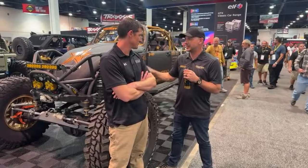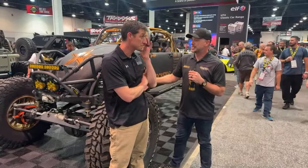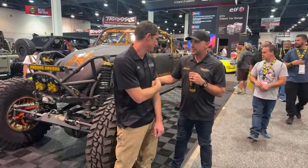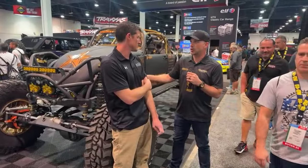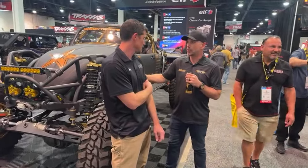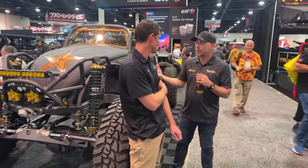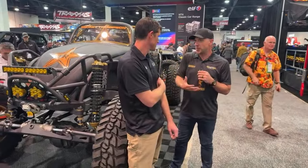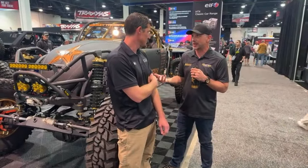Why I think this one is probably the most practical build for spools is because it's built in the styling of a moon buggy, right? But really explain to us why a spool is so much stronger than, let's say, a Grizzly or a Zip Locker or an ARB, things that people are more familiar with. Again, you can't run a spool in your everyday car. Yeah, it's going to throw traction issues, ABS issues, all that kind of stuff.